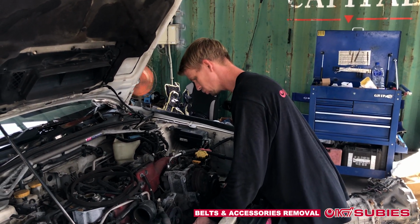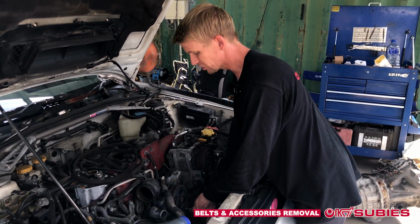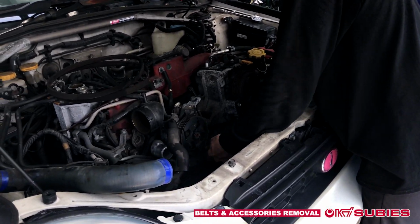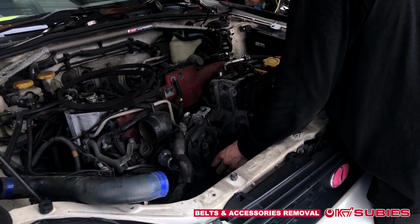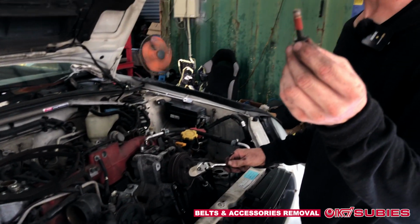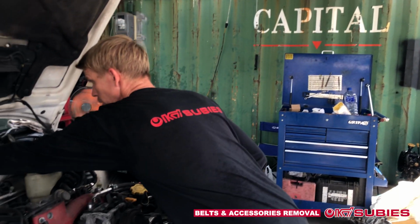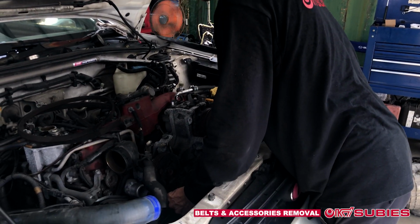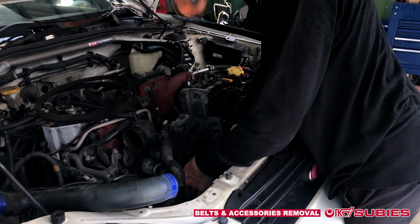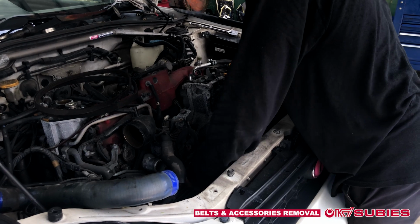So really simple. 2 bolts are the exact same length, and 1 is longer than the other 2. They have Loctite on them normally, so they're red like that, which shows there's Loctite from the factory. That's the long one. The other one in the front will be shorter, and the one in the back will be the same length as the one that we're about to remove.